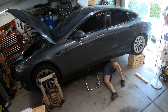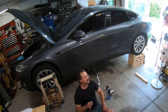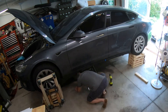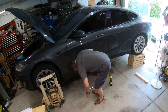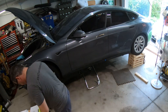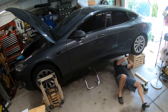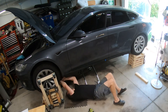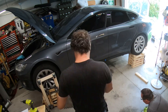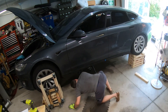Before this, I had already set the car up on the cribbing, put the jacks under there, and removed most of the bolts holding the battery pack on. What I'm doing now is putting on some blue tape across the battery and the frame of the car, and then I just cut the tape with a razor knife — so for putting the battery pack back on later, we just line up the tape. There were just a couple more bolts to take out, which I took out by hand.